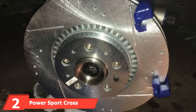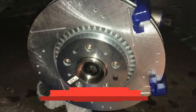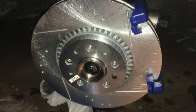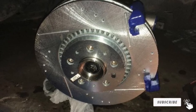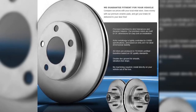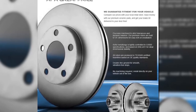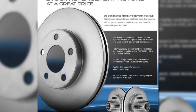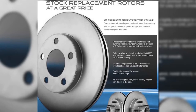At number 2, we have PowerSport Cross-Drilled Brake Rotor and Ceramic Pads Full Kit. This is another complete kit, though it is missing some extras such as a high-temperature lube. That means the price is a little lower, and you are still getting a new brake set crammed full of useful design points. The rotor discs are the eye-catching centerpiece — cross-drilled and slotted to allow excellent off-gassing and quick temperature cool-off, and also give the brake pads extra bite. The pads are a ceramic construction, always a good feature if you are looking for everyday-use brakes that won't be putting out clouds of brake dust or ear-shredding shrieks.